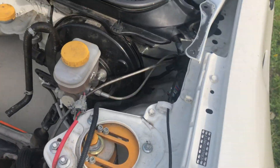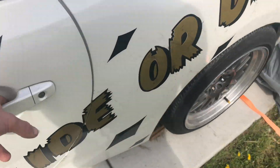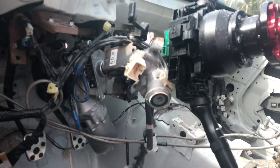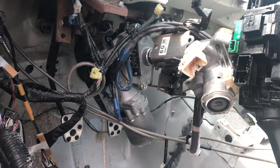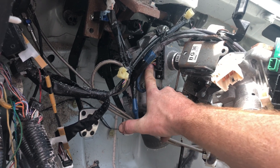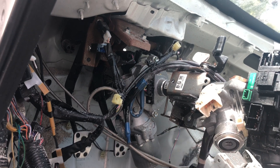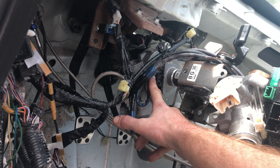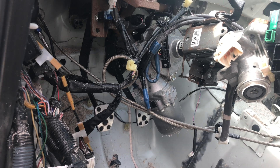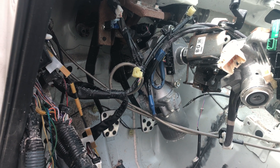I'm going to go ahead and pull out all the stuff that's not needed and save what I'll need for like the taillights and everything like that, and I can just run that to my switches. What's left is all the stuff that's under the dash — like AC stuff, radio, everything like that. I think my ignition relay is in here somewhere, I got to find that. Also, I'm going to have to figure out the power steering motor because it runs through CAN bus where it modulates it being on and off depending how fast you're going. But I'm just going to try to keep it all the way on — I got to figure out which one's the power and which is the ground so I can run it to a switch and actually have it on when the car's off. So if I want to roll it around, I can just flick it on and use power steering to make it easy to push.